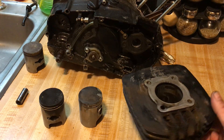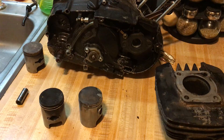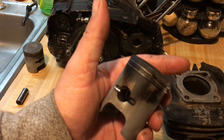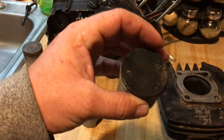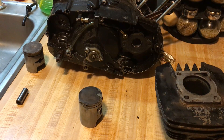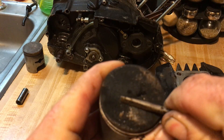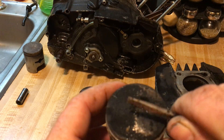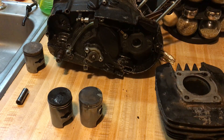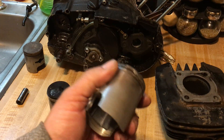When you get your bike back from the pit after it's cooled off, hose down your cylinder and make sure there's no crap building up. Also run good quality motor oil in your reservoir. This buildup is from high ash content — you can see the top of it is really thick carbon. You could scrape that off with a screwdriver. That's high ash right there. You want low ash, and you don't want to run lean.